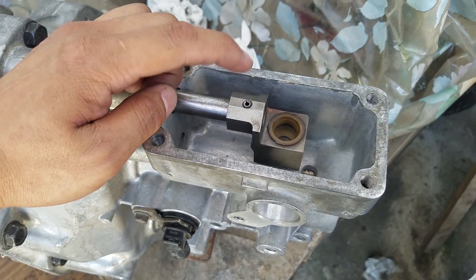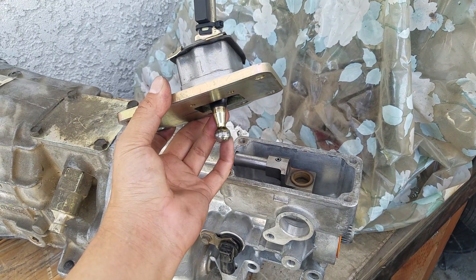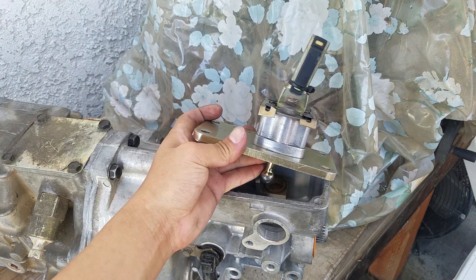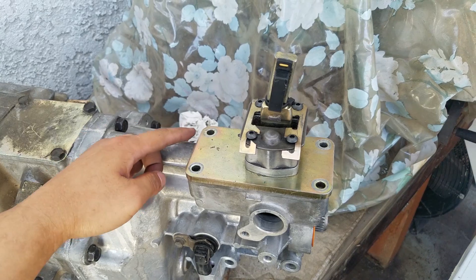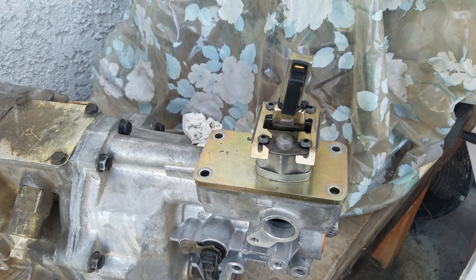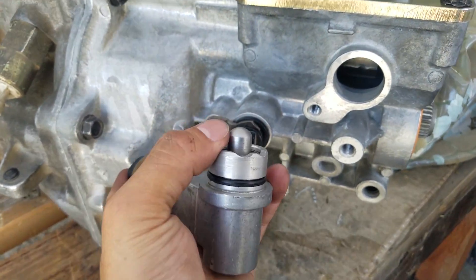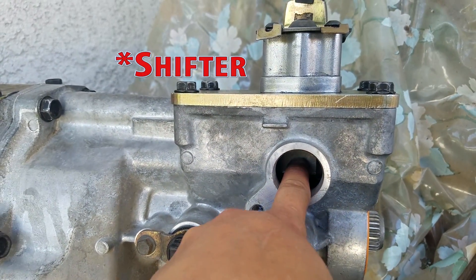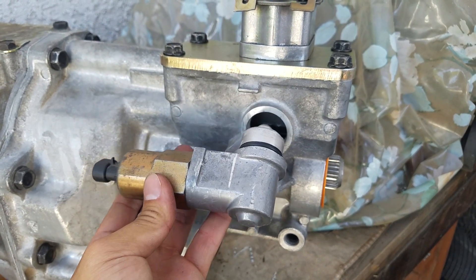I just tap this in with a hammer. Now it's time to install the shifter — it's simply just placing this piece down here into this area right here. Now I just got to bolt in the four bolts and I should be good. It's time to install the reverse lockout, and you can see the piston here pushes on this piece right here of the transmission. Hopefully it's much easier to put in reverse this time around.